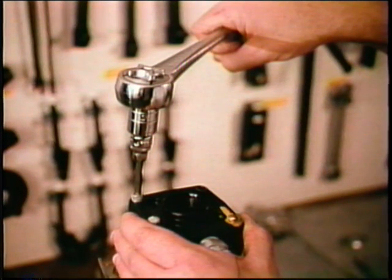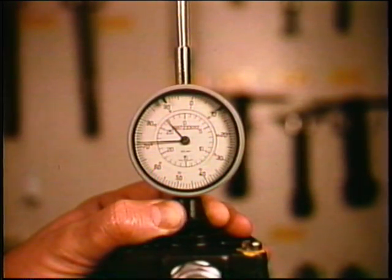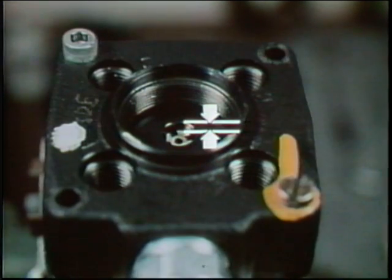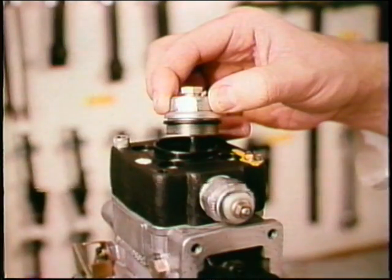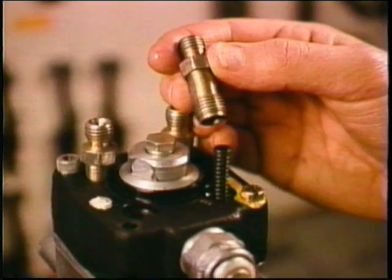Temporarily, and using just two screws, secure the head to the housing, leaving off the bracket. For zero pre-stroke pumps, you'll want to check the plunger BDC position with a dial indicator. Watch the dial indicator as you rotate the plunger to bottom dead center. On this zero pre-stroke pump, when you measure the plunger bottom dead center position, you're measuring the distance between the machined surface of the head and the top of the plunger at BDC. If necessary, change the shim under the plunger foot. Install the central screw plug into the distributor head and torque to specs. Install copper gaskets, delivery valves, springs, wear washers, and holders.